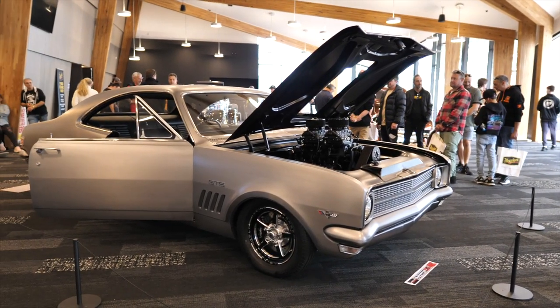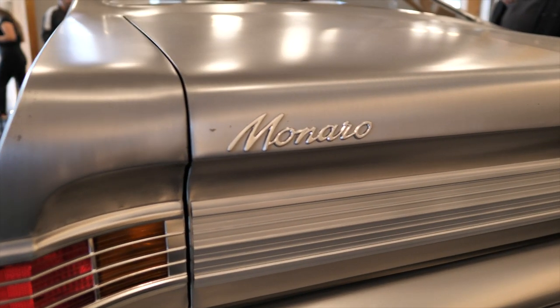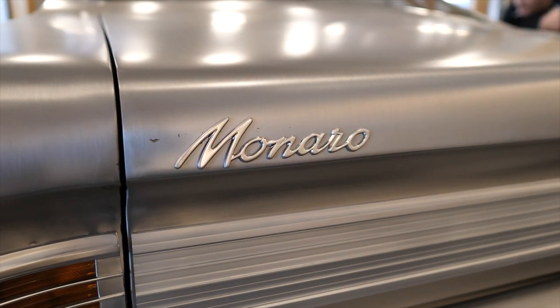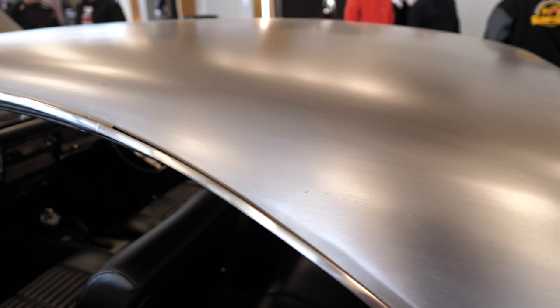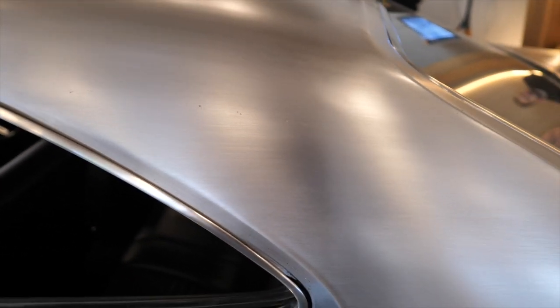The owner came to Andrews Restorations to have a bit of rust work done on it, and they did such a good job on the rust repairs that the owner said he actually wanted the whole car looking like that. So what they've done is pull all the panels off, inside and out, prep it all, rust proof it, put it all back together — and where all the joins were, they had seam joins from the factory. They've cut all those seams out, welded metal in, filed it up, and there is hardly a join left in that car. It's like the body has been pressed out of one whole sheet of steel.